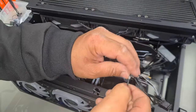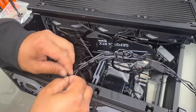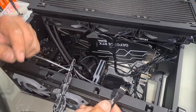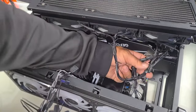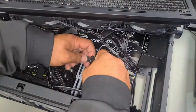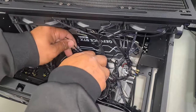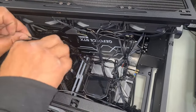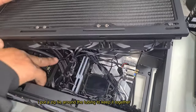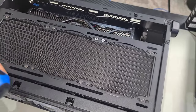My cable management isn't perfect and I'm really starting to get into these ITX builds. When it comes to ITX you really have to be a bit vigilant with cable management — it's going to help you out in the long run. Keep the cables nice and tight. We've got a PWM connector right here, so we need to plug that in, and for our 5V 3-pin we've got another one that comes off the splitter. Plug that in, pull the piggyback off and plug that in — now everything should be in sync coming off the one 5V 3-pin header. Let's give it a quick test and cut off all the extra zip ties.